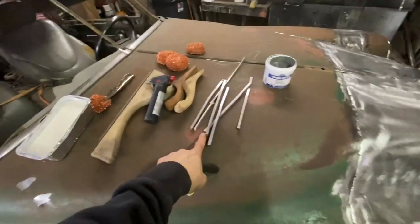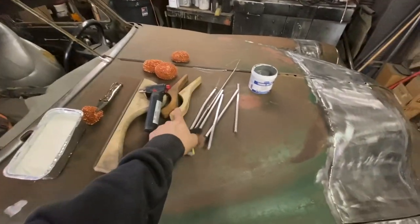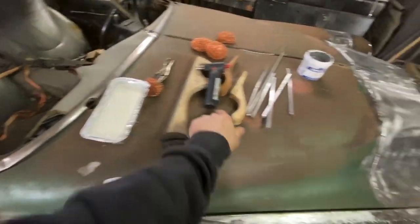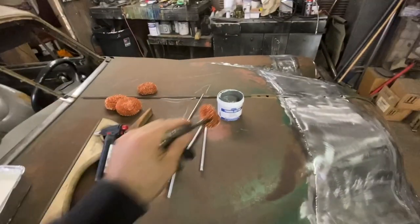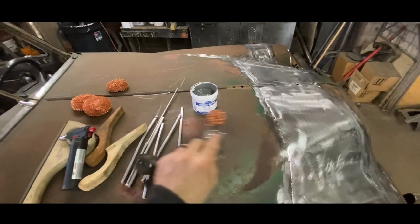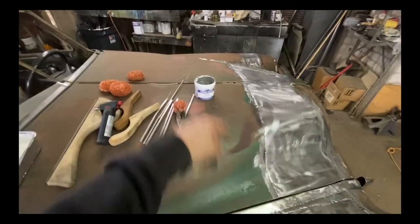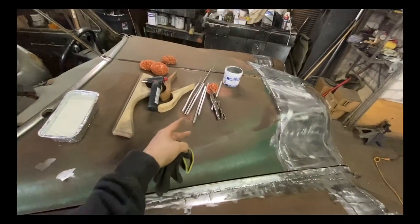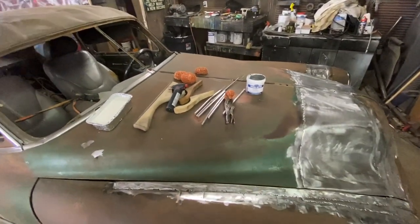We got our lead ready. Everything's clean — brake cleaner, everything's good. Also clean your lead because it gets dirty. Files. These are your wooden paddles to move it around. Tinning butter, tallow — this is basically just wax. You get wax on the wood so it doesn't burn it. First thing we got to do is dip this in here, get this hot, and then you put that on there first — this is basically like a first layer. Then your lead will stick to the tinning butter. Also get a fan going, get an attic fan going. Even though this is non-lead lead, there's still toxic fumes, so I will have my gloves on and also my face mask.